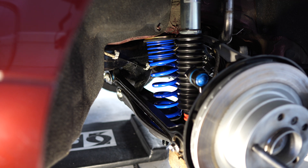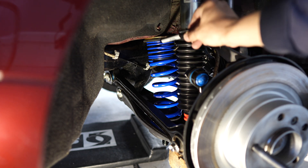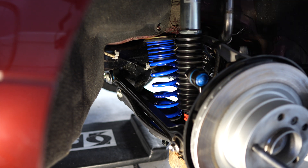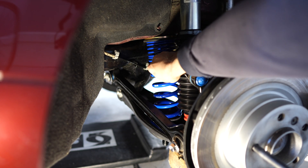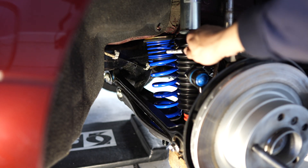When you lift the car up to replace wheels or tires, or when you basically put the car up on a jack or stand, the suspension unloads. Or when you corner fast — the helper spring is basically taking up this space and keeps the main spring captivated in its seat.